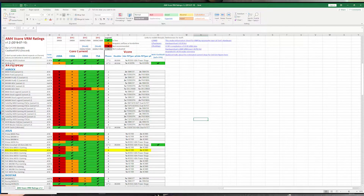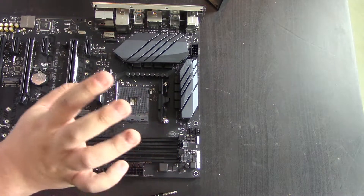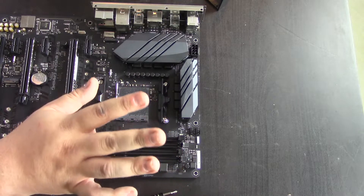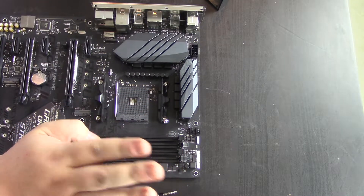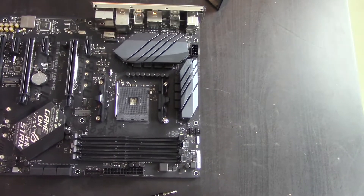I'm going to disagree with this, based off of what I've seen: it says it should be able to handle up to a stock 3950X. I'm going to say no, unless you have Precision Boost Overdrive turned off. I would say this would be a perfect budget board for like a 3600X, 3600, 3800, or 3700X — that's my take.